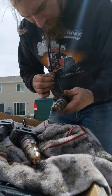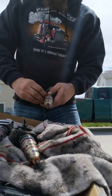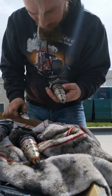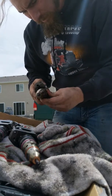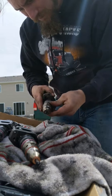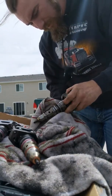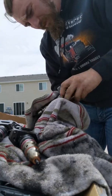All new on here. And then you've got your metal ring. Just pop it up over — just like you're doing a piston — work it around, pop it in the next groove, work it around, pop it down, work it around until it comes off. Take my rag here, clean all this up.